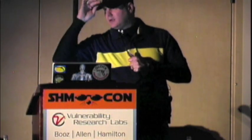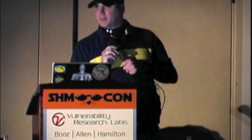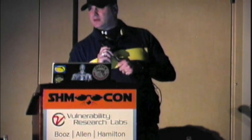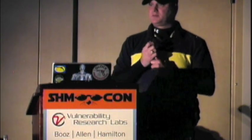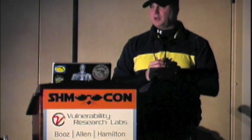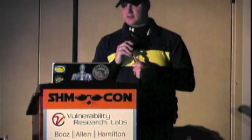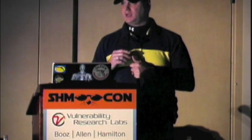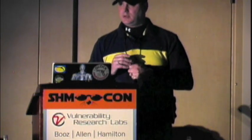Actually, related to that secure erase, I heard someone say that these drives actually encrypt themselves and they can secure erase instantly by effectively forgetting the key. There are some like TPMs and some BlackArmors and stuff that can do that, and so you're right that if the key is erased or wiped, but not the standard traditional drives that are still sold on the shelves. They still actually have to go through the whole process, but they're fairly quick at it. But they don't just erase the key. But some of the newer encrypted ones have some other alternate methods. I can still read the content from them, but I can't decode it.